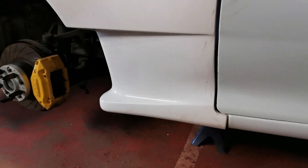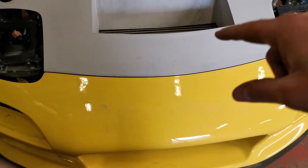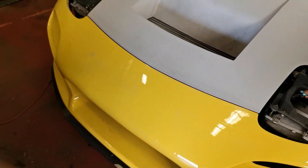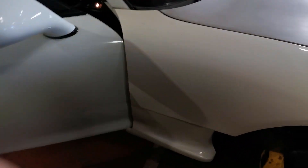This side step sits on there anyway. Bonnet line — it's not too bad; I can always put a little bit of material in there, and I reckon when it's painted the same colour it'll look alright. Now the bonnet gap is what I'm really focusing on, because I see so many RX-7s where the bonnet gap's a mess or the angle of the bonnet doesn't meet with the bumper and it just makes the whole front end look off. So I'm going to spend quite a bit of time getting that tidy. The wings came out alright — that's probably just one skim of filler, sand most of it back off, and that should be perfect. Next job is sanding — we'll get the DA out and go over it.